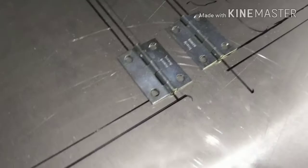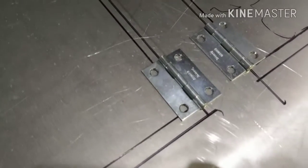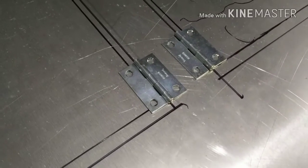Except for the middle — this hatch is going to open this way, and this hatch is going to open up that way, all pivoting into the middle. To create the most room for the hinges, I made it so the rivets — I'm going to rivet these hinges on — so I don't want the rivets to go into the support, because then you've got to drill holes. So I figured out where the best place to put the center cut line is, where there will still be an overlap so the hatch is still supported, and the rivets will not go through the supports. Then I marked and traced that.